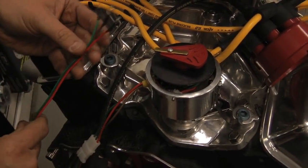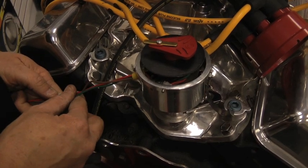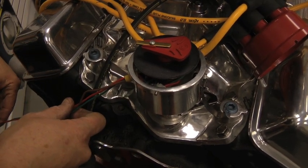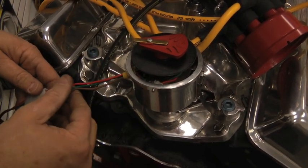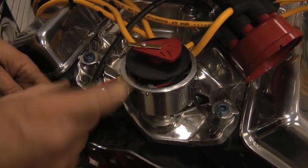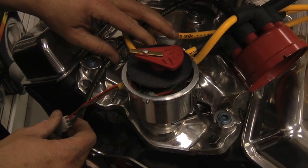The last phase is making sure you have a coil that is 1.4 ohms of primary resistance — or you're going to need to buy a ballast resistor if you have less than that. I'll say it again: if you have a coil you need to have 1.4 ohms of resistance or you're going to burn this module up. Make sure you have the proper coil with the proper resistance, then batten it up with your cap and attach your coil wires.